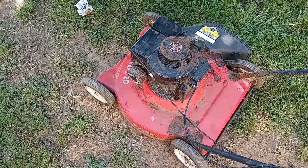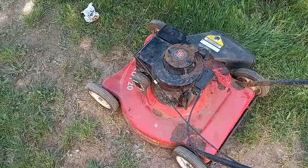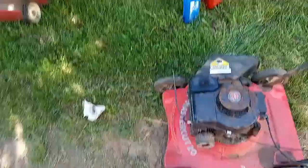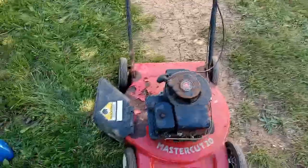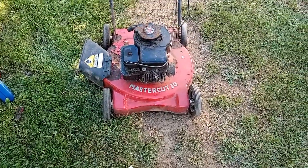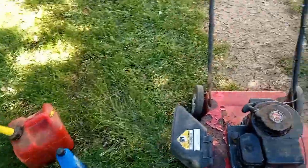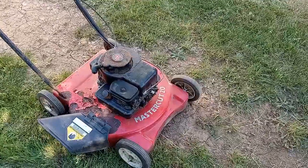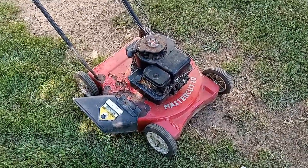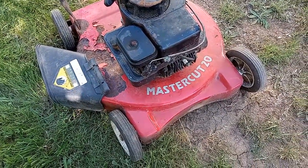Now the VacuJet carburetors, they do have a tendency to sometimes run good, and then once they get hot, they'll start giving issues. So it'll be something to see later as I actually do some mowing with it, how well and how long it'll actually run. But it's running pretty good too. I could hear it kind of sputtering just a little bit, not too bad though. But it's probably that carburetor. I didn't touch the mixture adjustment on the carburetor, which will probably need to be done.